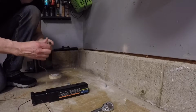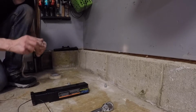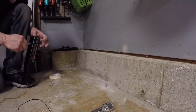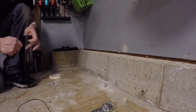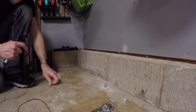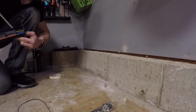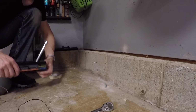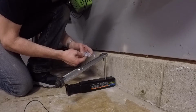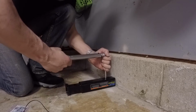It's kind of funny. Not that much different from using fish tape on installing the hitch in the first place. All right, so I'm going to drop this down through here. Okay, extension is on. This is harder than I thought. Okay. So I pounded it in like it said, and now I'm tightening, and it says to torque it to 55 foot-pounds. So that's what I'm doing.